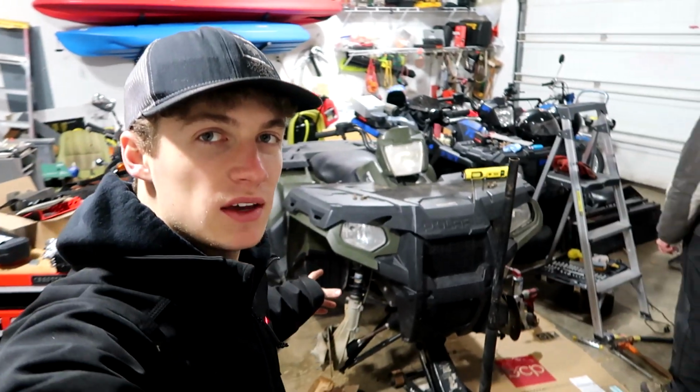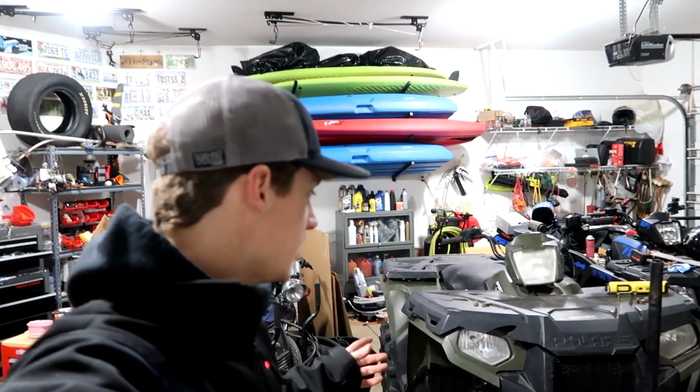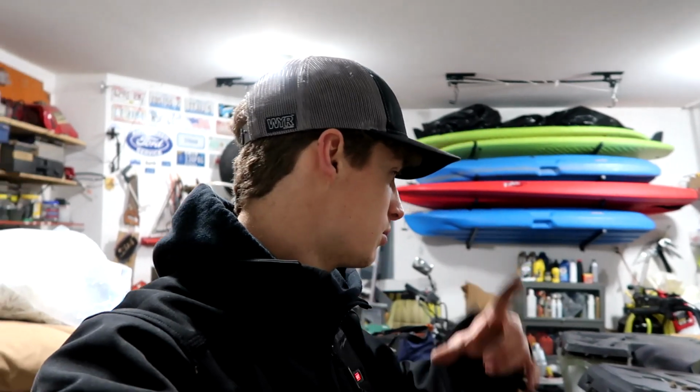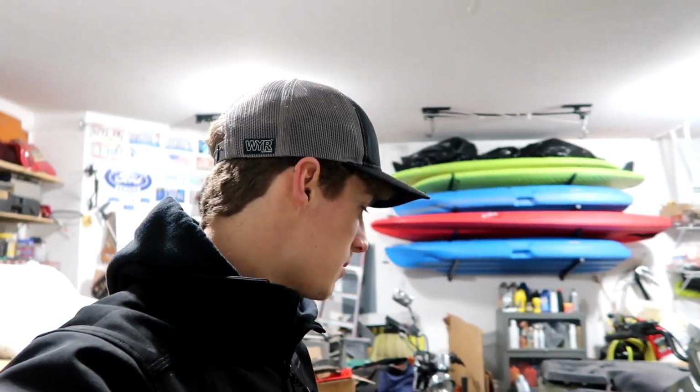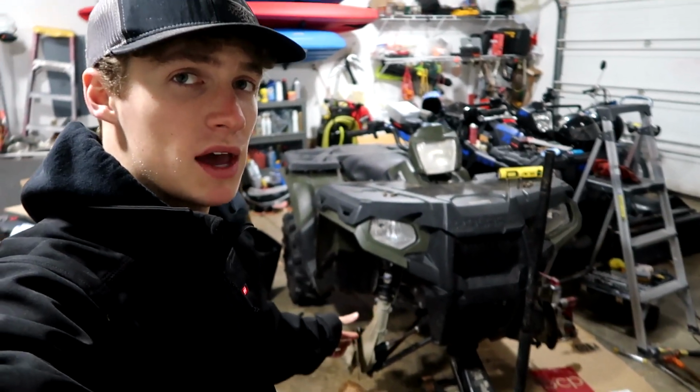So that clip of me accelerating back and forth in the garage, you can see that it kind of now stops the four-wheeler, which it didn't do before, so I'll take it as progress. But also the steering, I was tilting the handlebars and there's no more play in the steering, so I'm super happy about that. And yeah, I think the smoking gun is maybe the brake pads.